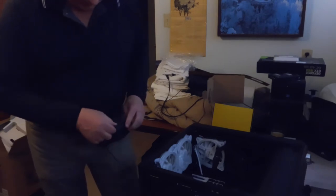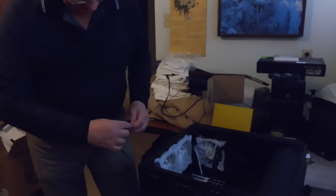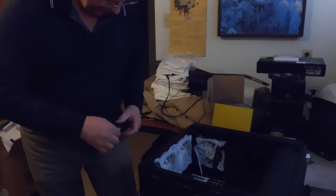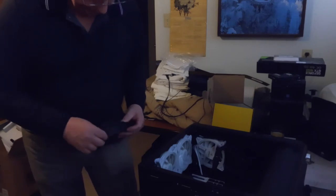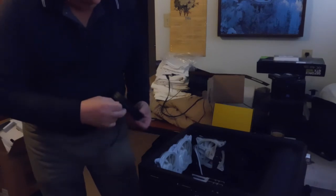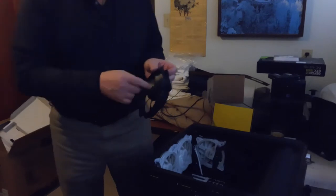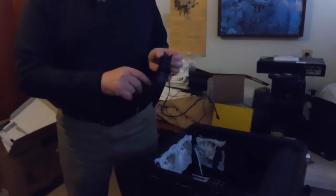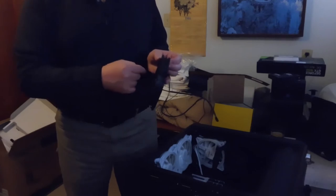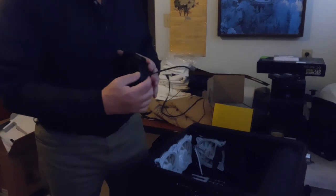You have one pushing and one pulling. Nobody goes anywhere. How are you looking at the fan and you know which direction the air goes? Because of the shape of the blades. That's the backside. It never turns that way. It always turns this way. Yeah, you can tell that's the backside.